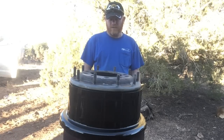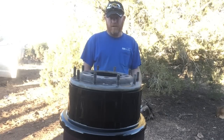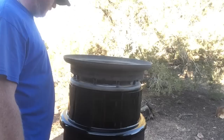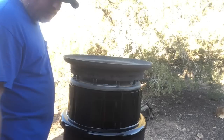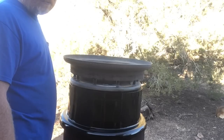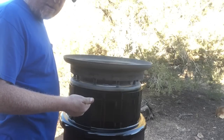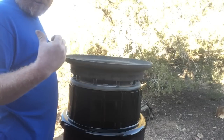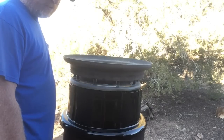Now all that's left to do is let it cool down, and then I can sandblast the other surfaces that'll be wrinkle black — which is going to be this whole side and then all the inside. As you can see, it can be done outside in an uncontrolled environment with what you've got around, because I ain't got an oven big enough for this thing and I don't think there's very many people who do. So I just figured I'd show you how to do it so you can get something done for your truck or anything else that you have as big as this, using just your powder gun and one of them radiant heaters.